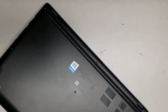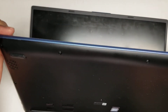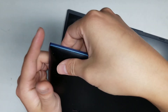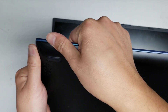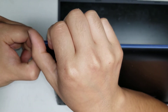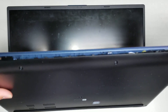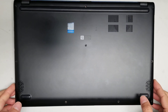Once you get all the screws off to remove the bottom cover, open the screen a little so you can grab the bottom piece and hold it with your fingers on the bottom, then push with your thumbs on the blue part. When you do that, you'll see it pops open. Then hold the black piece and slide your fingernail or pry tool in between the two layers. Do that all the way around. After you get the sides and the front out, the back side you don't have to pry — just lift off the cover.